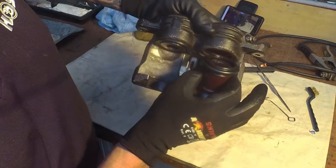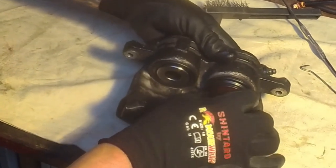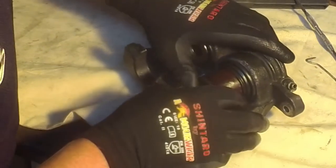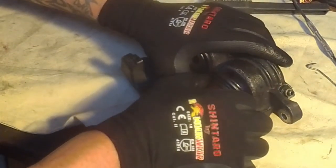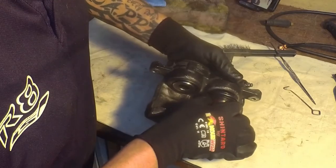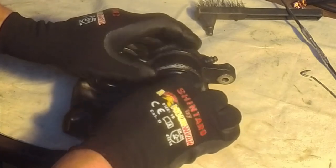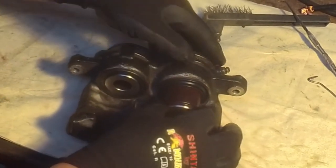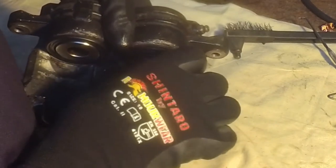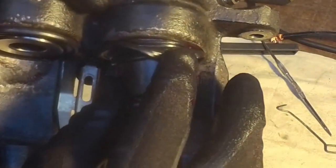Get that bottom edge and try to get it into the bottom edge of that groove like so. Maneuver it around so the bottom edge gets in - you've got to tilt it down on a bit of an angle. Tilt it, make sure you're continuing to keep that dust boot hanging out because otherwise it doesn't want to sit in properly. Push that as much as you can with your thumb around there, maneuver it in, and then when the piston looks like it's in, try to rotate the piston without pushing it in because you don't want to engage the square seal yet. I can see it's in on the bottom but there's a gap on the top.